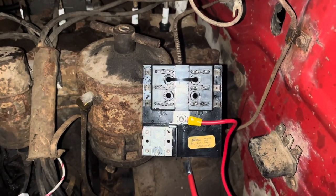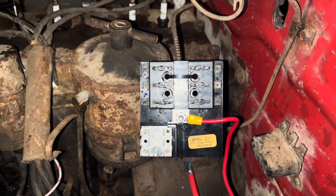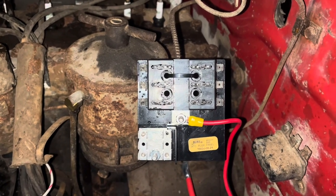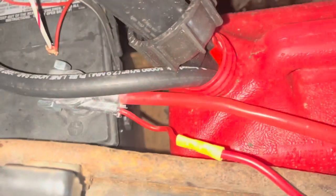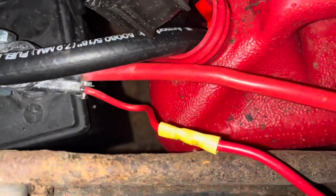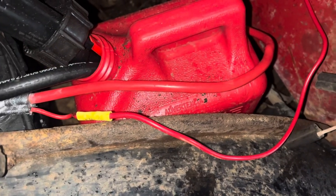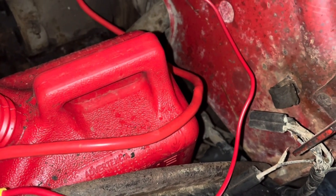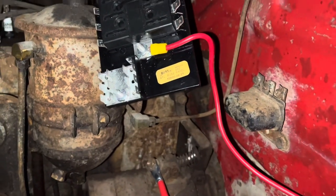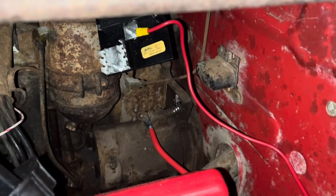Because I'm here in my home shop, I'm completely lacking in necessary supplies like self-tapping screws. So for illustrative temporary purposes, I have to fix this with a zip tie. The little elves will definitely come around later and screw this to the firewall. No. No, they won't. Power source for this little fuse panel comes from battery positive. Often I'll use a loop connector, but in this case there's a tiny little wire here already. Now, there really, really should be some type of breaker — around 100 amp maybe — or a fusible link, or something here, to stop this truck from burning to the ground in the case of a catastrophic failure. But I like to live dangerously, and this is a very limited-use vehicle which will spend most of its time sitting right here with the battery unhooked.